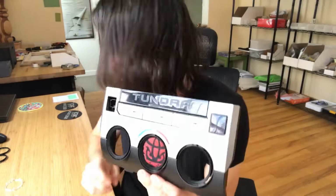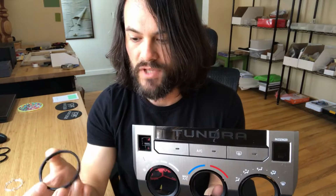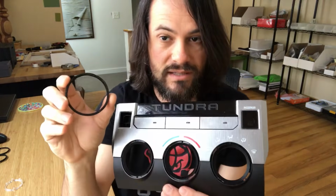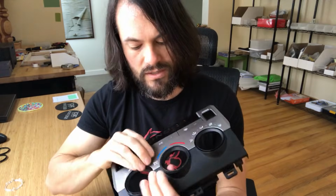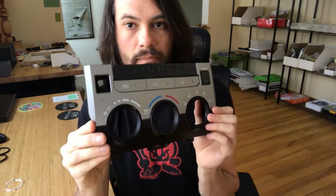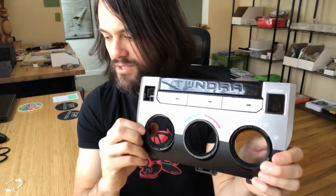And again, this is for the 3-knob deal. Same thing. Obviously, you don't have the centerpiece. And what you want to do when you snap these rings, you take the center ring here. That goes in the center section. Notch lines up at the top. Press that in all the way around, like so. And then put the side rings in, just like I demonstrated on the 2-knob version. Exactly the same, and that's all there is to it. Again, I pre-disassembled this thing just to make the video go a little faster, but all the procedure is the same. And that's really all there is to this.